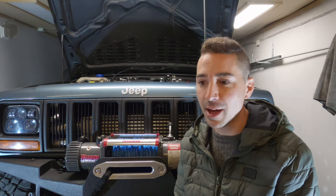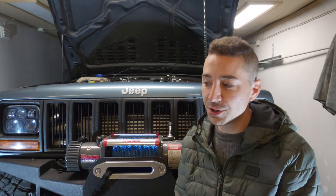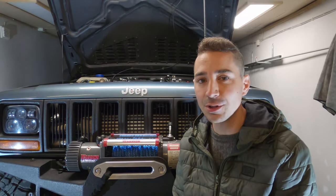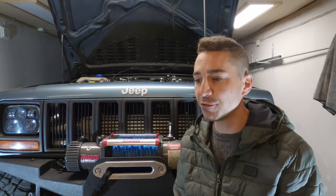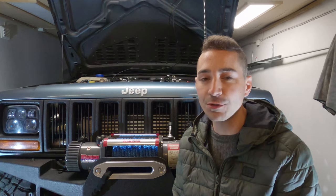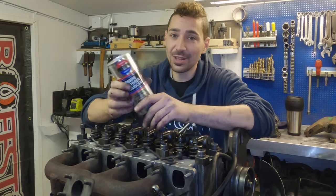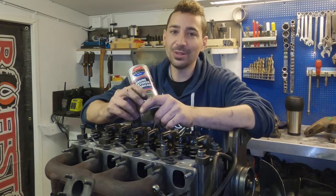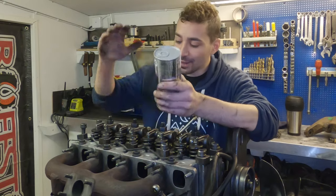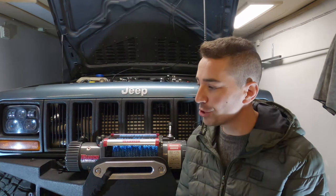If you're way below that, then obviously the engine either needs a full rebuild, which is something I would tackle first if you really intend on keeping the engine. Or maybe first off the bat, I would try an engine additive. Something like Aimtech Engine Restore is a product I use quite a bit. In fact, I use it with every oil change. I'm not affiliated with them, by the way, but it is a good product. I'm not going to go into a huge amount of detail of how it works. So that would be my first point that I would check.